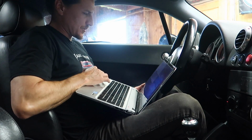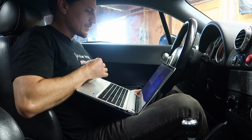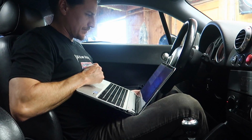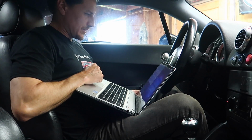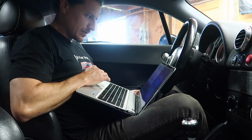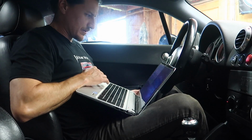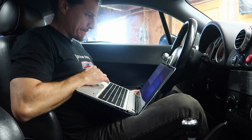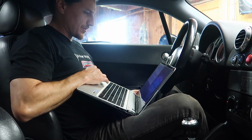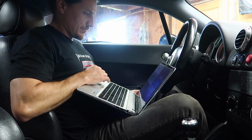Go on to number 22, all drive system. Then you go down to output tests, start tests. Pre-charge pump is off, pre-charge pump on, the all drive clutch disengage, clutch engaged. I think I heard a move, pump off. So that was the test. It's complete. Nothing showed up. Now I'll go to fault codes, no codes. I don't know, I think it should be good.